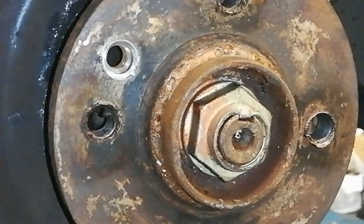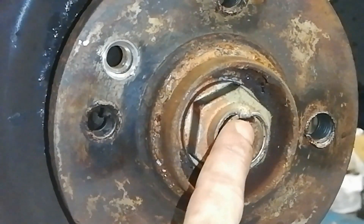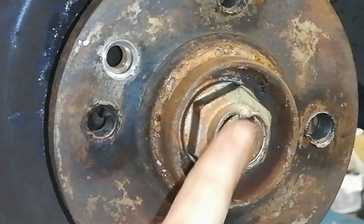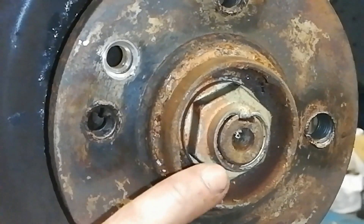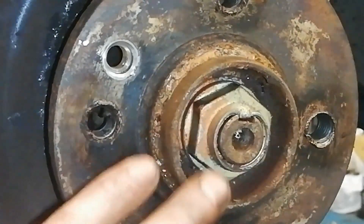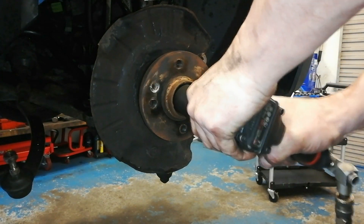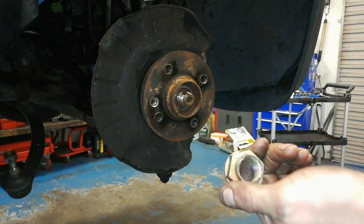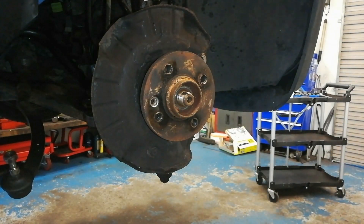Okay, we'll have to move on with this job. Next is this hub nut that's holding the drive shaft - this drive shaft nut. The immediate notice is it's staked here. Sometimes you see people try and undo this and they're all day doing it and end up butchering it. So with a decent impact gun, you just wring it off the way it is - we don't touch that. And there we go.